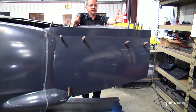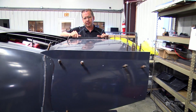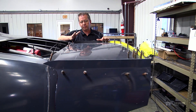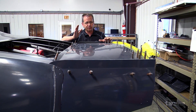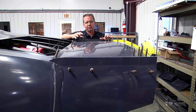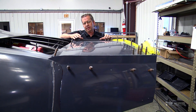We have these in 18, 20, and 22 inch. They're longer for more downforce, obviously. We found that an 18 is really a pretty good number for the cars that we build. Even the fastest door cars out there — the NHRA Pro Stock cars, anything running 250, 260, 270 miles an hour — we are running an 18 to 20-inch deck on that.